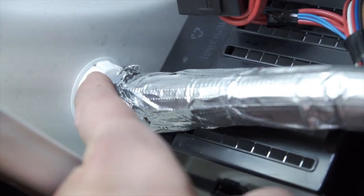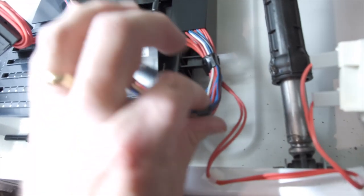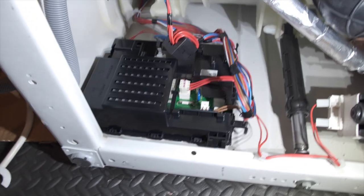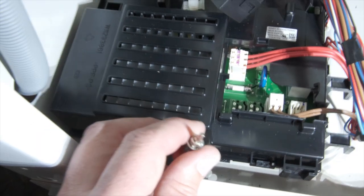There's the piece I need to replace. First I have to move this hose out of the way — there's a little clip in the back to undo. Then I need to pull some of this drain hose inside so I can access the board. According to the instructions, the first thing you do is press these two little pins right here, and this pops up giving you access to loosen up the wires. There are also two little levers in the corners, and that L-shaped cover pops off. Then there are two screws down there that require a star-shaped bit to undo.